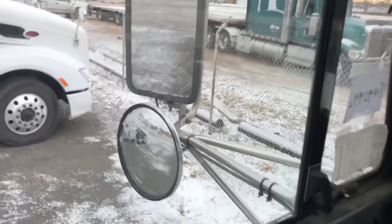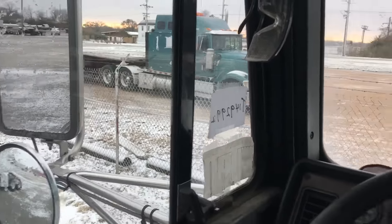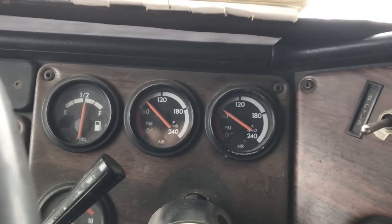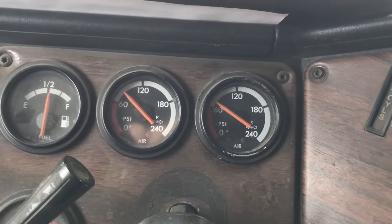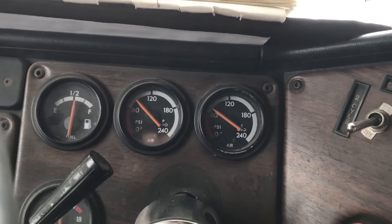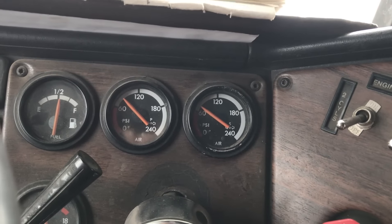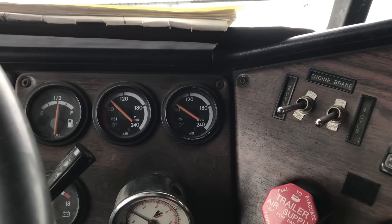This is a cold first winter morning here in the St. Louis area, down around 20 degrees. It's kind of premature because we're just into our second week of November. It shouldn't be that cold yet, but it took me a long time to get this truck to start taking any air at all. I'm only showing about 70 pounds of air right now, and that's because I was passing a blowtorch underneath the air dryer.